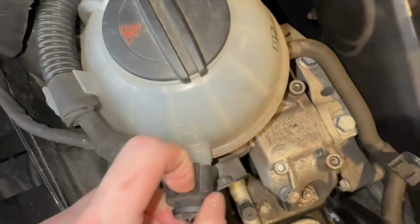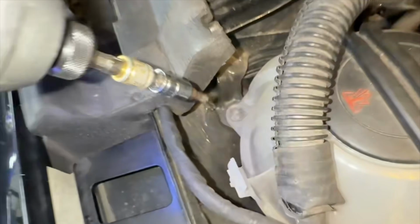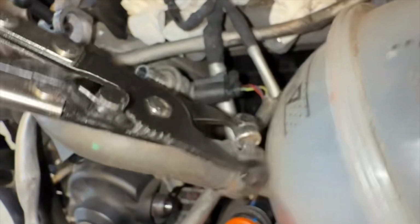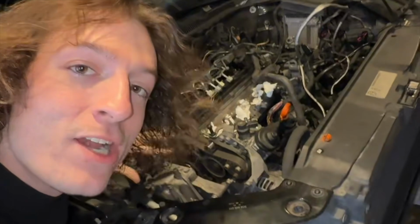First, I'm removing my coolant ball sensor. Then I'm gonna remove this wiring harness. And now these T20s are exposed. Although we could just move the coolant ball to the side still attached, I'm gonna use these special pliers to remove it. Just like that. Now I'm gonna pop off the 3 timing cover clips. It's as simple as that. Now our timing belt and gears are exposed.